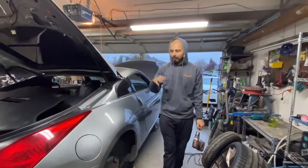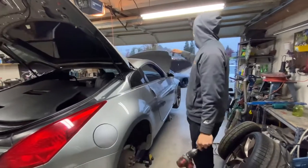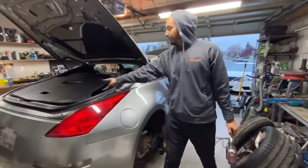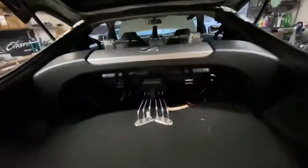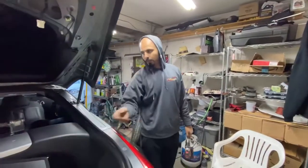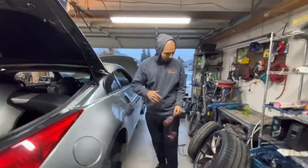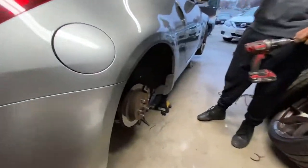We're at the point now where we've got three wheels already bolted on. We basically finished up the rest of the inside - we just have to connect the grounds and the powers and then connect all the airlines from each bag into the hard line. Afterwards we'll set the car down once we have air in the bags. For now we're finishing putting on the last wheel, making sure everything is nice and tight and secure.